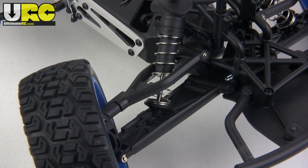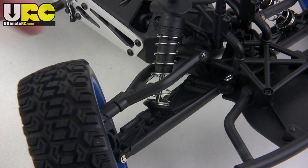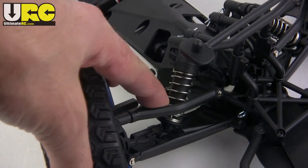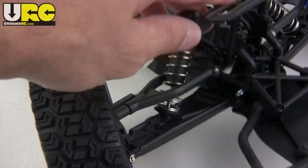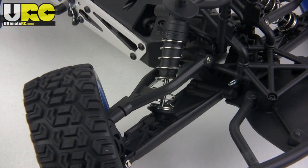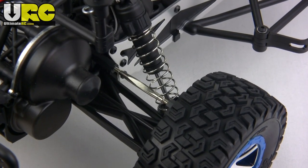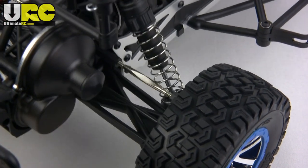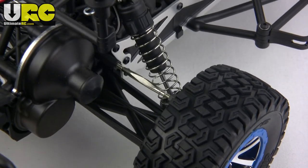It looks really cool and seems to be pretty sturdy, but there's not a lot of adjustability — one upper shock mount and two lowers. Camber is adjustable, though up front you do need to remove one screw to do it. The plastic-bodied shocks do seem pretty well built, but there's a lot of progressiveness to the suspension. The front is a little bit on the stiff side and the rear maybe a little bit soft, but I feel they both stiffen up too much when you compress them.